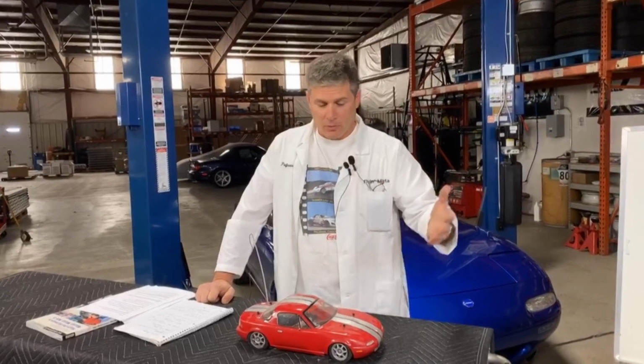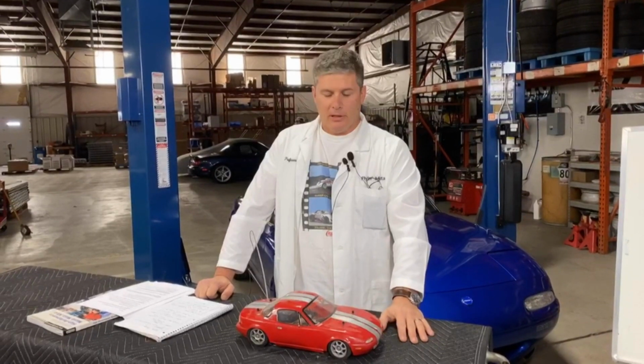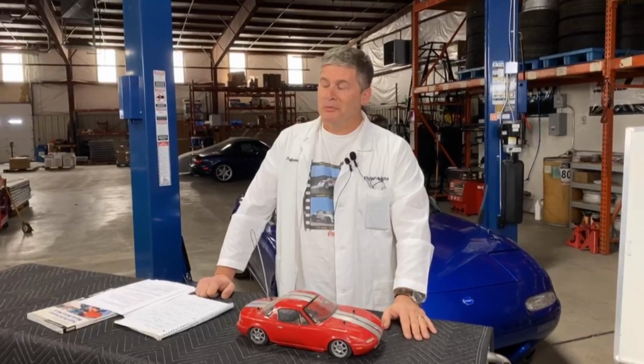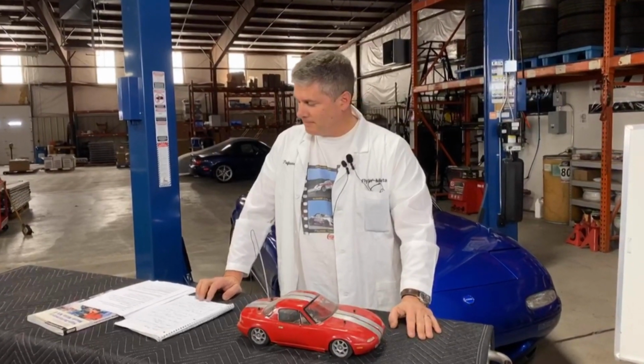But yes, we have the same problem with engines too: the more cooling air you have going through the thing, the better it will cool. And if you have 15-20% less air, there's less to cool with. So yes, you are going to have a harder time shedding heat at altitude. If you're running down Pikes Peak, that's a factor. They actually stop you halfway down Pikes Peak and check the temperature of your brakes. One of the reasons for that is because they don't cool like they should at lower altitudes. When you're starting at 14,000 feet or whatever it is, that's important. It's also a long hill.